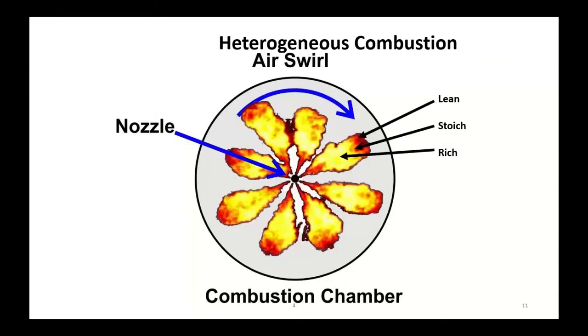All right, now, the fuel on a diesel engine is injected directly into the combustion chamber under that very high pressure, and the tip of the injector, which sits in the combustion chamber, has multiple nozzles, a lot of tiny little holes, to get that fuel to come out so that we atomize it, or break it down into very tiny fuel droplets. Droplets are going to interact with that heated air in the cylinder, which is going to cause the fuel to burn. In order to promote proper combustion, an excess of air is necessary, as well as a strong motion or swirl of the intake air. Besides creating more power output, turbocharging assists in this process. If you look at this drawing of a combustion chamber, the tip of our injector sits in the middle.